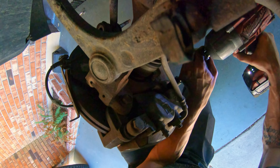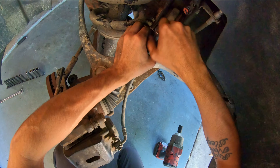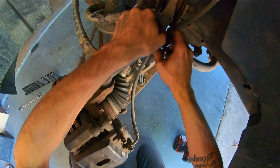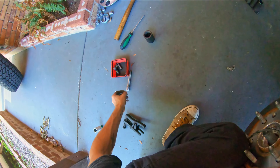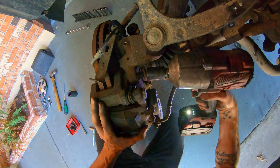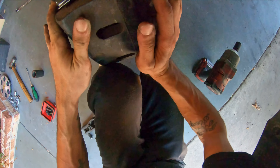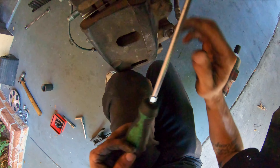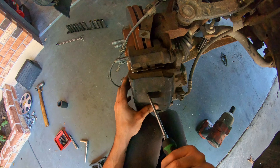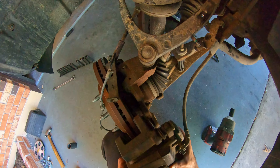These are 18 millimeter bolts for your brake caliper. I'm just going to take the whole thing off — take these bolts off so I have a little bit more room. Make sure you have something ready to tie the caliper up out of the way once you get the bolts off. These have yellow Loctite from the factory, it's pretty strong. Now, before I take this brake caliper fully off, I'm going to stick something down in here and pre-compress this caliper — just a little bit. That'll make sliding this brake caliper back on 10 times easier when you're going back together.